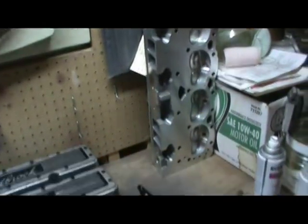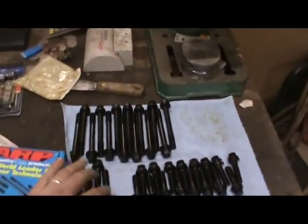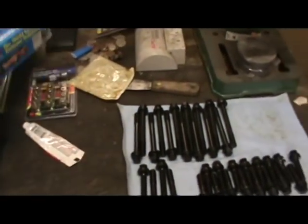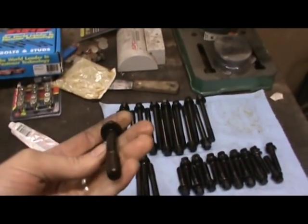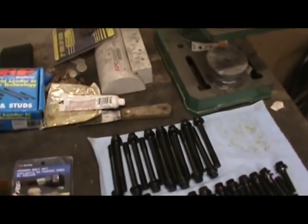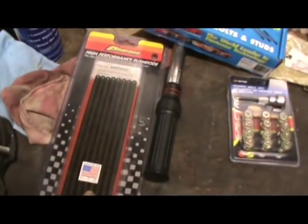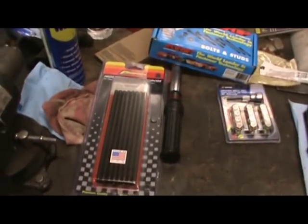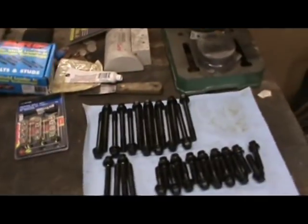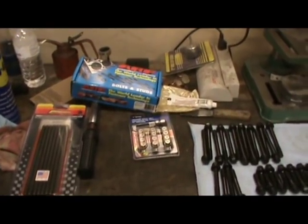Got the valve covers cleaned up, and there's one of my heads there. Got that thermostat housing all painted up. I've got some new head bolts and stuff for it. Here's our head bolts — it's ARP head bolts and it's got the washer with it. To me that'd be essential with that aluminum head, to have the washer. This is stuff that dad had bought years ago and never got around to putting on before he got sick. He also got a new set of header bolts and some Proform high performance pushrods for it — standard length, which will work fine since it's got regular lifters, not roller lifters. I'm going to wrap this up. Hopefully I'll get around to installing the heads tomorrow.